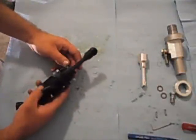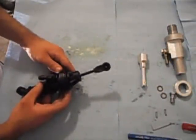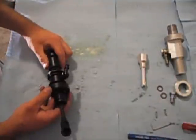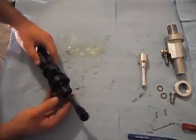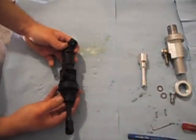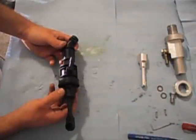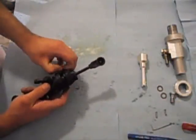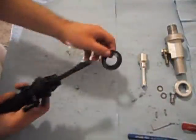What we have here is the factory master cylinder. We're going to be showing you today some tips and tricks on how to install this properly without having any damage done to the upgraded new master cylinder seals or plunger and bore assemblies. First, you're going to want to remove the factory plastic master cylinder out of the car, as there is some disassembly that needs to take place. Remove the firewall seal off of the factory master cylinder.